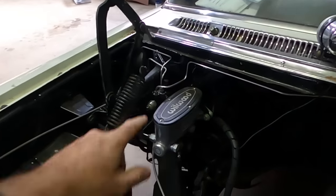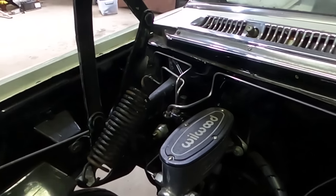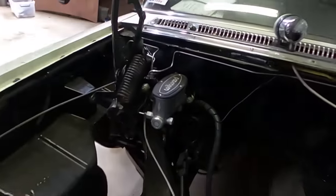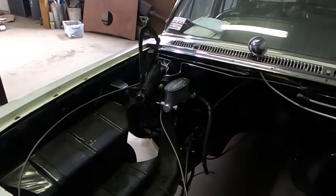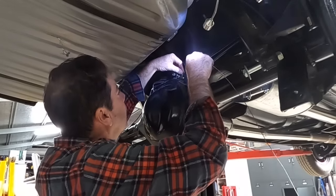And if you see on the EH the brake lines that he made up around the master cylinder and the proportioning valves, they're actually kind of intricate. There's a few turns and that sort of thing right across the firewall. So made all them. And down here, made all them from scratch, just using that technique. Use your wire as a template and then go from there. And thanks, Egg. So I'm just going to start at that end.